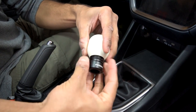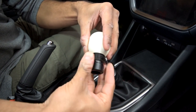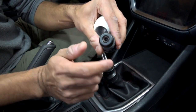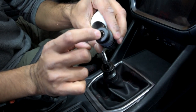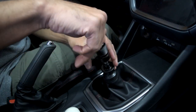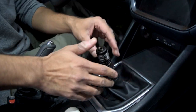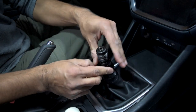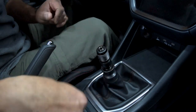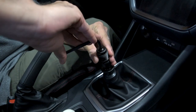There is an O-ring on the inside. There's the lockout — this is what you use to actually lock it in place. What they suggested was you tighten this up until it's tight, until you feel it, and then one turn backwards. So I'm going to turn it one turn backwards. Then I've got the handy Allen key they gave me, which I'll use to tighten things up.